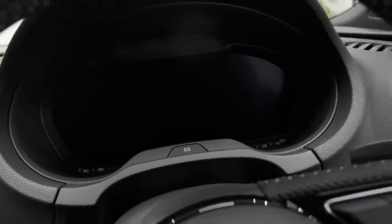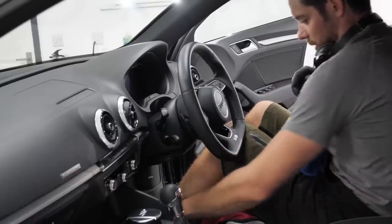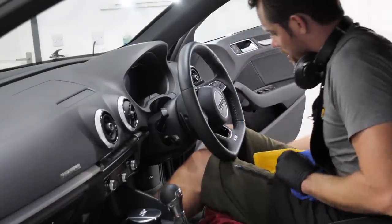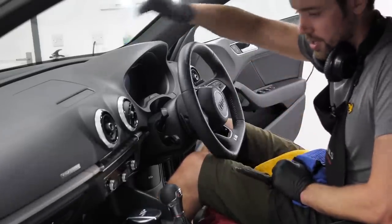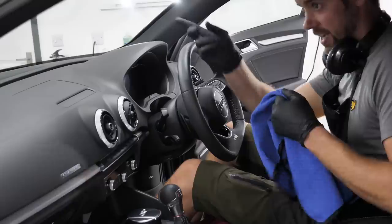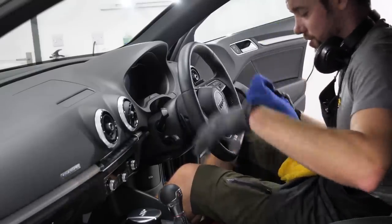And that's all that should need. No smears, no smudges. Clean. Never to be disturbed again. On that note, in the winter, when your car's possibly condensed on the inside, try and avoid using them foam yellow sponges, the blocks that you can dry the interior of the glass down. They're awful, and it will look awful when it dries. Try and allow it to evaporate with the car's system.